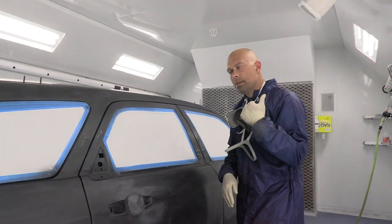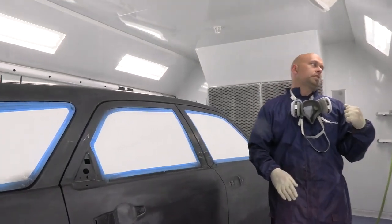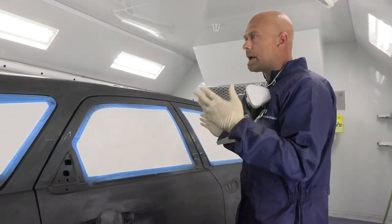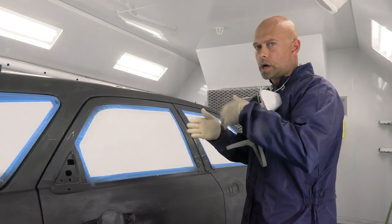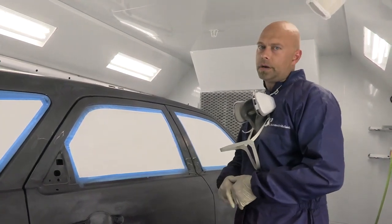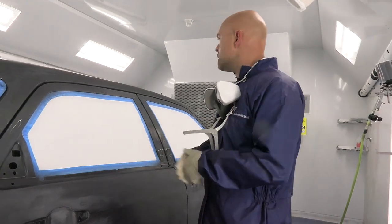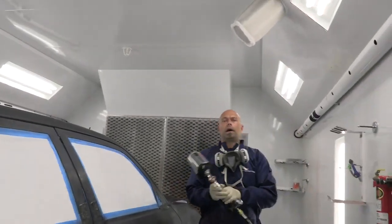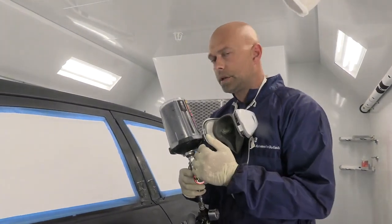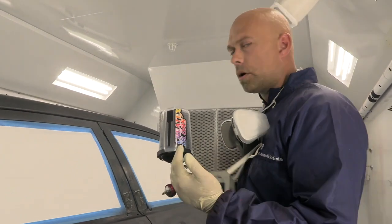I have a little bit of autoborn black sealer mixed up, 10% 4011. It's about 88 degrees and 70% humidity, so I'm right on that line. I'm not super concerned because we'll wait a little longer between coats — it'll actually help give me a nice wet overlap so I don't get dry spray. Pay attention to conditions. We're in a booth so we can control humidity to an extent. I'm using my Iwata LDX with W400 LDX air cap, 1.3 tip, right around 20 PSI. I close up my fan about a quarter turn but I'm wide open on fluid control.